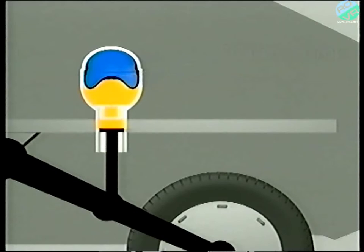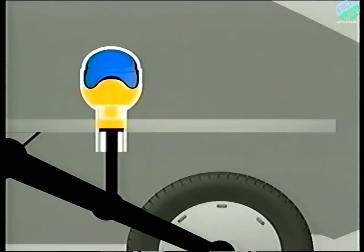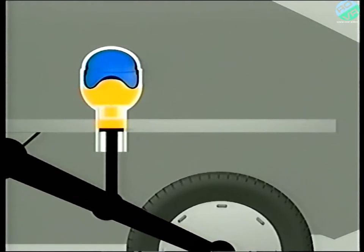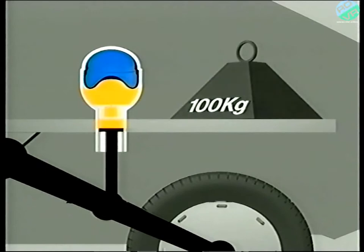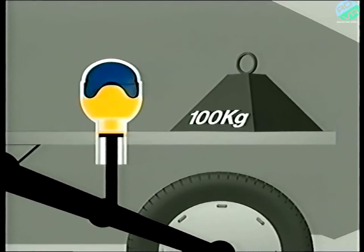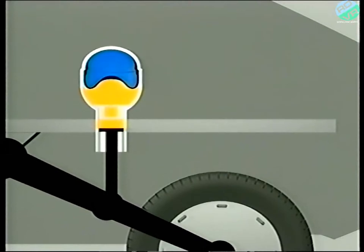The sphere is attached to the wheel by a cylinder and piston. The gas acts as a spring would do in a conventional suspension system. If a load is applied, the gas becomes compressed as its volume decreases. When the load is removed, the gas expands and the system returns to its original position.